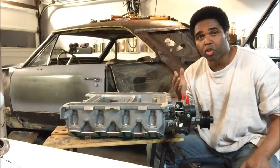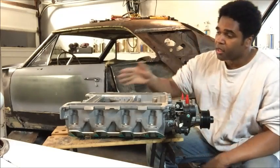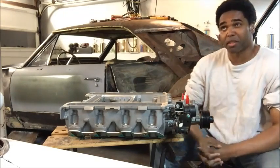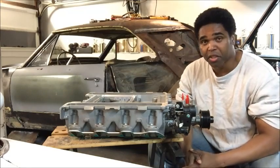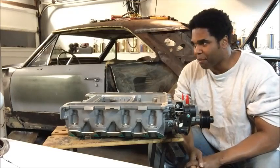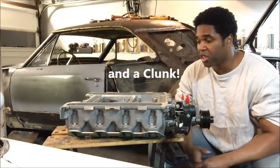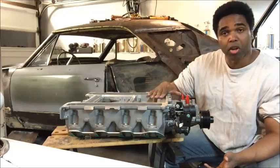In theory it's kind of cool because when you decelerate or accelerate, it doesn't put too much of a strain on the lobes. But the problem was people were dropping — a ZL1 was like a $56,000 car, and the Cadillac V-Series was north of $70,000 to $80,000. People were dropping that kind of heavy dough on cars and a couple weeks later you'd hear a whine. So eventually GM said let's recall all the superchargers back.